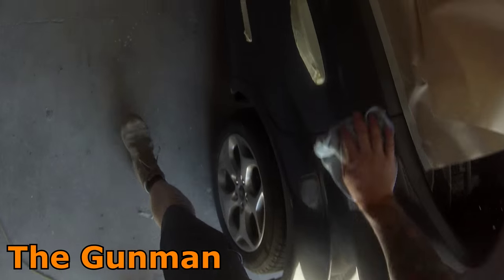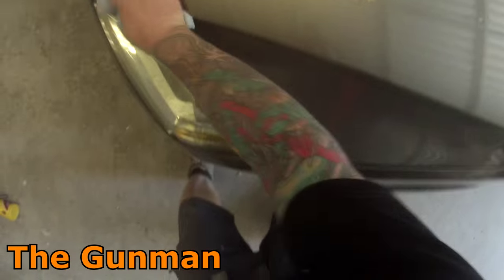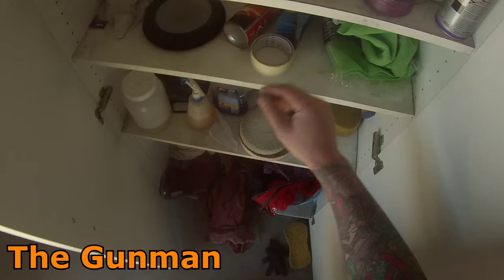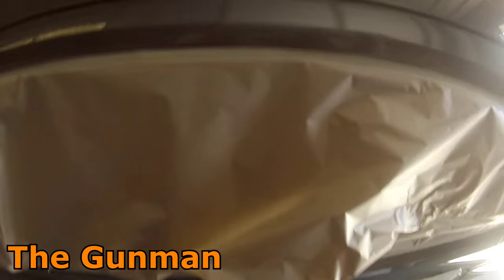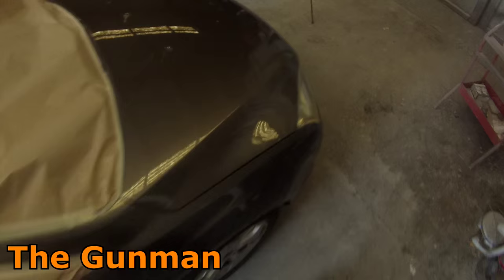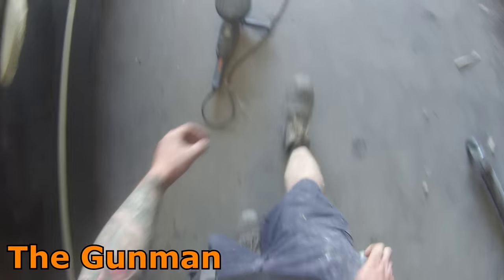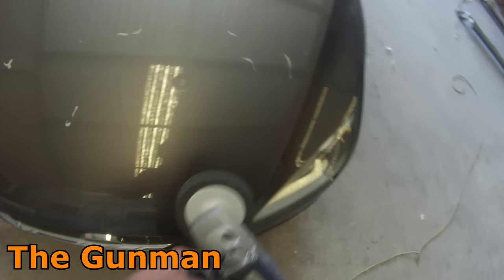If this owner had kept a nice coat of wax over their car every three months, the paint wouldn't have deteriorated so much because you've got a protecting layer over the top. If it's just sitting out in the beating sun every day, especially mid to low range production cars, they don't hold up. Higher-end cars like most German cars - the paint lasts a lot better. They seem to use high solids clears or VOC clears with UV resistance, whereas a car like this is probably done in middle-of-the-line clear and just doesn't hold up in the West Australian sun.